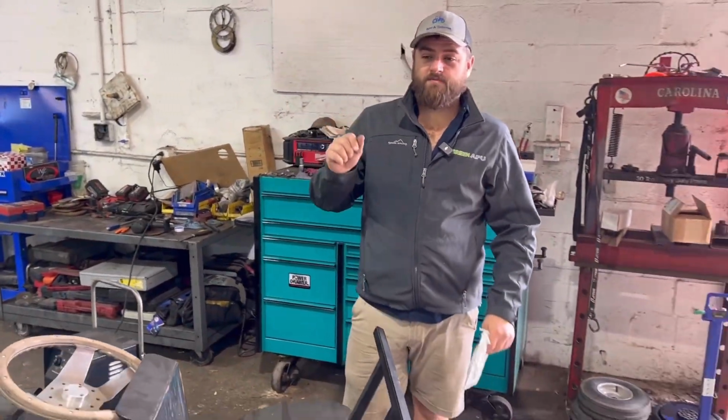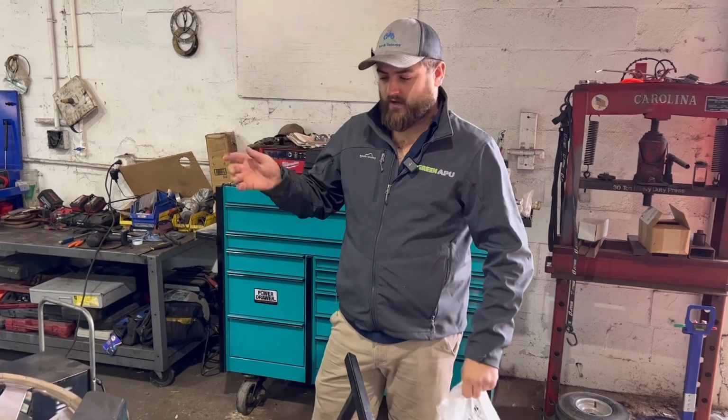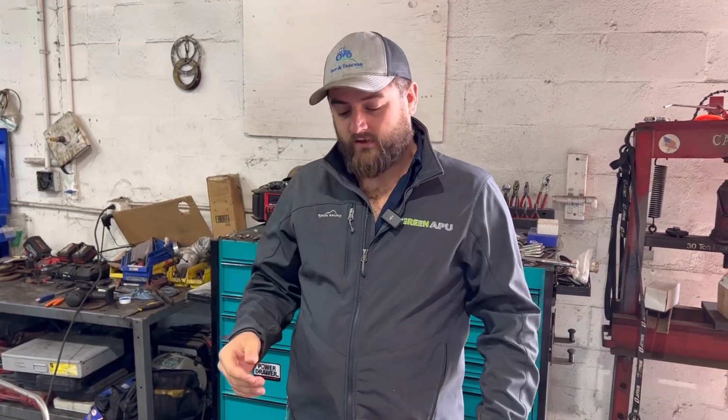We got this thing put on charge. We're gonna run to the machine shop in Zephyr Hills. They're taking the cylinder head for our 5.9 Cummins burnout truck. They've got the short block done, which it's not built. We've got to put it together, but they've got the pistons, rods, crank, everything balanced. The block has been machined. Pistons are cut to lower compression.